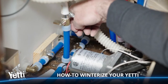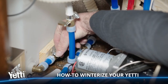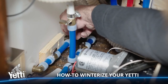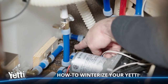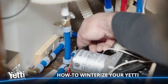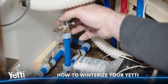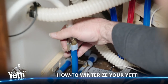The first step is to drain our fresh water holding tank with this valve. By giving this valve a quarter turn, all the fresh water will leave the holding tank and go to the ground. Once the tank is draining, we go to the valve that feeds fresh water from the tank to the pump and give that a quarter turn to close it. Then we turn this RV antifreeze intake valve a quarter turn as well.